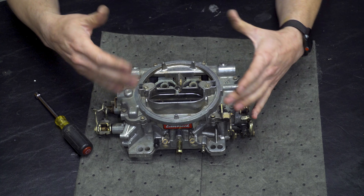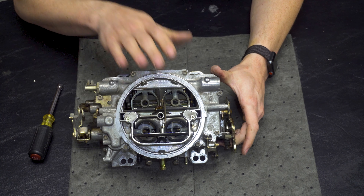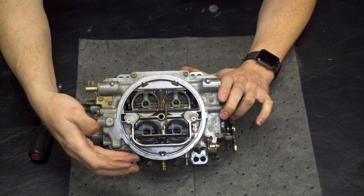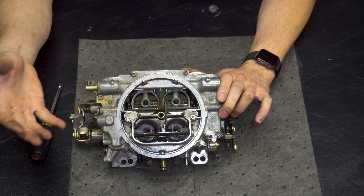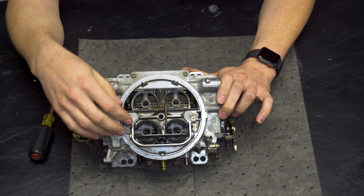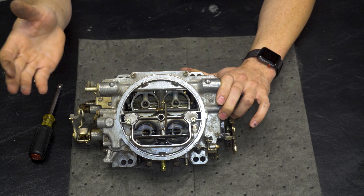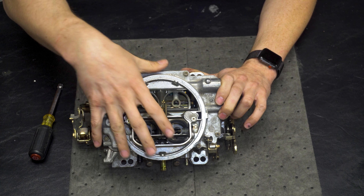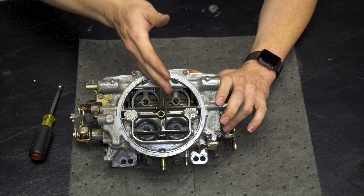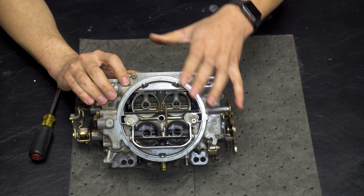There are a couple of other things that correspond to what we see on EFI, and those are things like accelerator pumps. Carburetors use an accelerator pump design that, whenever you start to open the throttle, gives a little extra amount of fuel to help with that lean spike when you get that onrush of air. On EFI we use different things like fuel-on-wall calculations, predicted torque throttle variations — all these different things that say whenever we move from one state to another, from steady state to transient, add additional fuel to counteract the air. The carburetor does the exact same thing, only mechanically. There's a direct correlation to how this worked when it was designed and when they started doing EFI — EFI is replicating what the carburetor does.